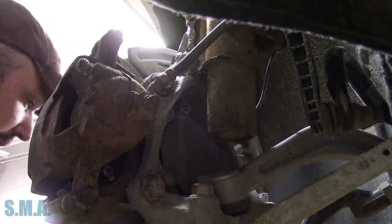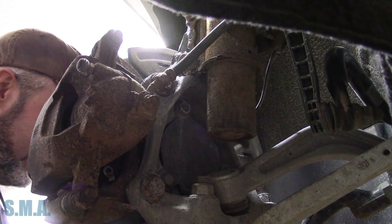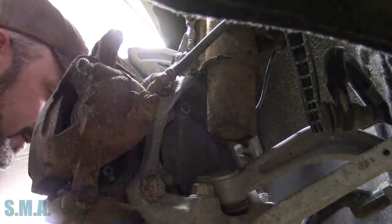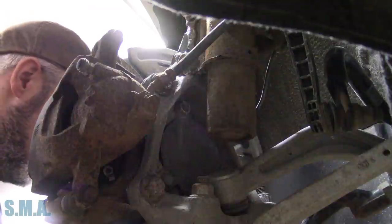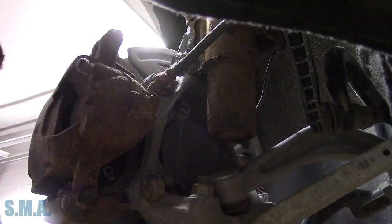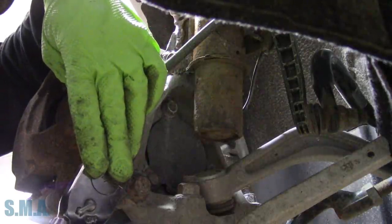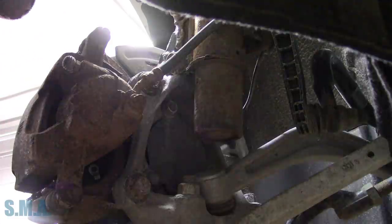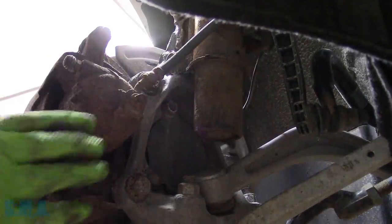I think we have a half-inch torque wrench — it's probably a little overkill but I do have a 10-mil socket for it. Let it calibrate and then we're going to go to 21 foot-pounds. There's 21 — 21 foot-pounds achieved. Double-checked them; that's why they didn't move much. So that's all good. Your caliper should move freely like this one does. Everything's free.